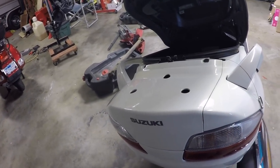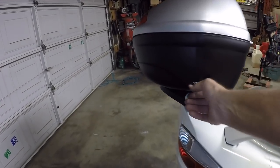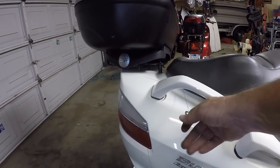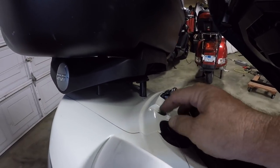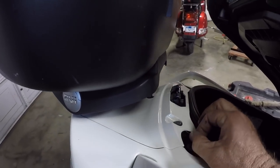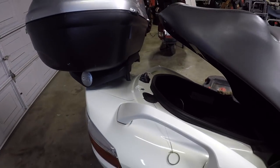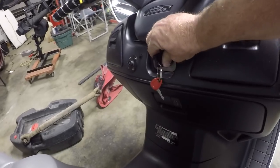All I've got to do is put my top case back on and we're in business. This is the finished product with the top case back on. If you have a headrest, make sure once you get everything back on that the routing of this cable is run away from the pin, because the first time around I had it binding up on the pin. Once you release it you won't be able to close it because it will hold tension on it. Make sure the routing of that wire is done properly.